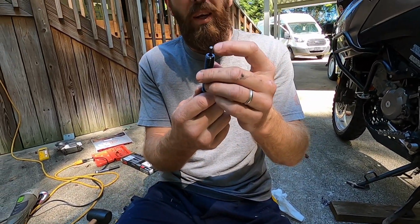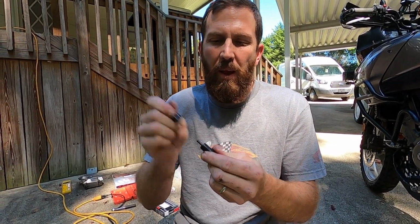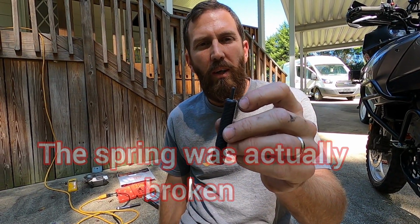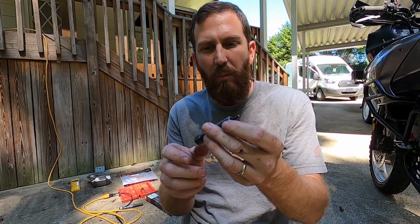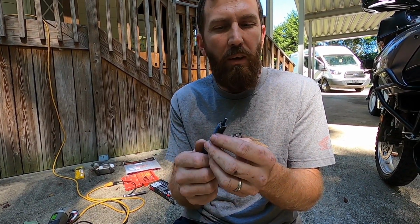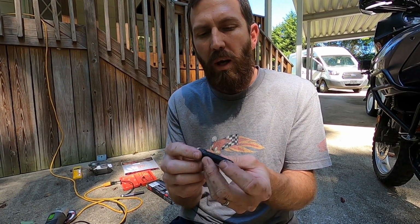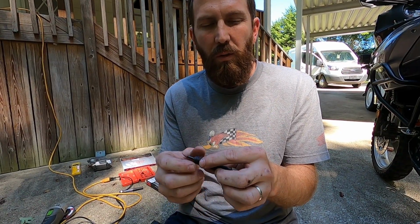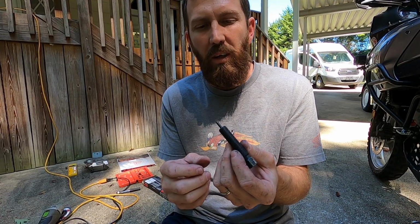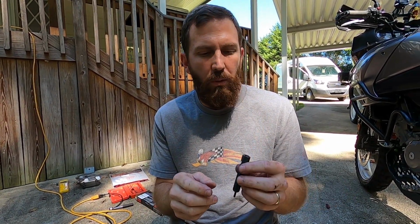But just breaking the chain off the bike and breaking the new chain, that pin's got bent already. So we're gonna try to beat that out. Hopefully the rivet tool is a little bit better, and at least get this one master link riveted. So I guess the tip of the day on this one is, you probably can get through one chain putting it on the bike with this cheap Amazon tool. But if you're gonna do it a lot, buy a name brand one, which is about $80 to $120. This one's 25 bucks, so I didn't expect much.